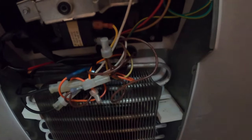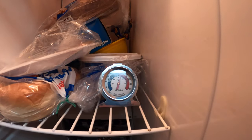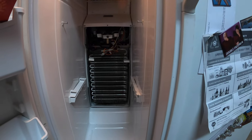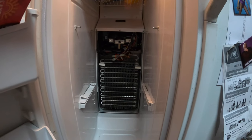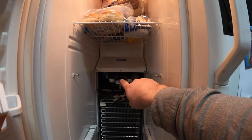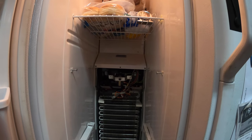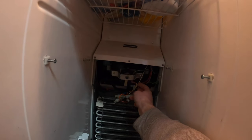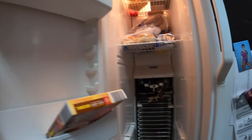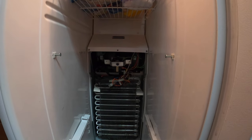You may notice there's a little bit of ice here on that coil — not a lot. I think it just finished the defrost cycle. The temperature wasn't great — it was down about 20-30 degrees before I opened the door and started working on this. When I pulled the panel off, the fan was not running, so I pulled the fan out thinking it was bad. Turns out the fan's not bad — I wired up a plug and plugged it into the wall and the fan ran. So something must not be sending power to the fan.